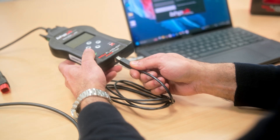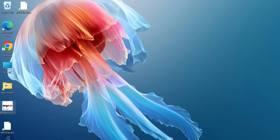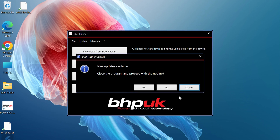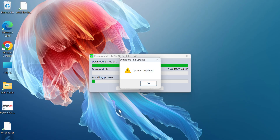At this point you can plug your ECU flasher into your computer and open the app — it will then do the automatic updates. If it asks you to close the program and proceed with updates, simply press Yes and accept the license agreement. At this point we can unplug the flasher and take it down to the vehicle.